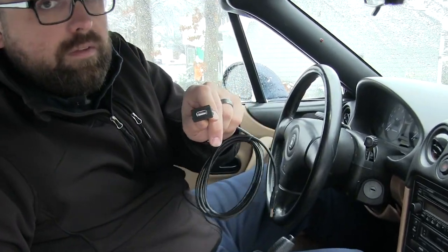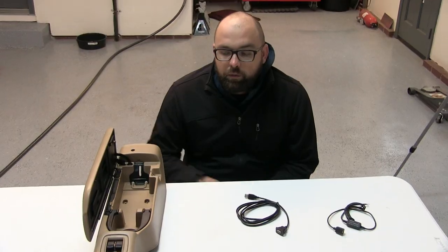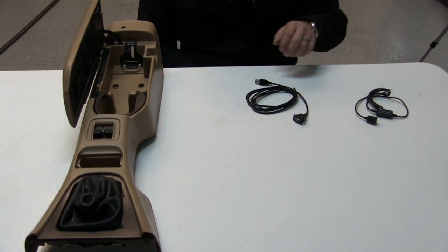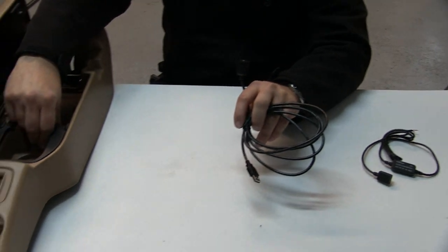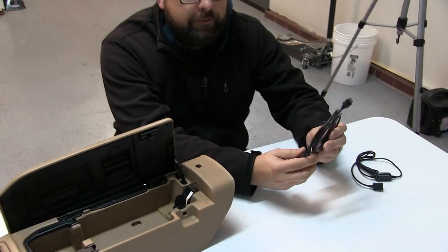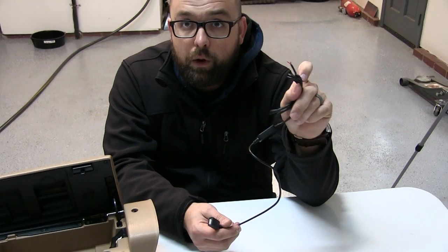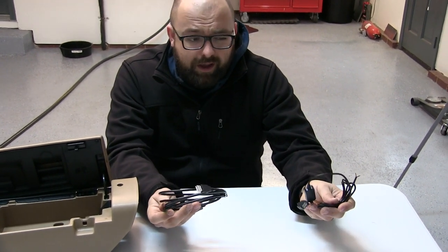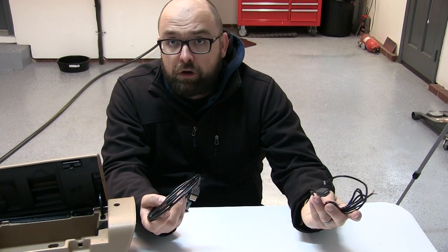This is the part that will be sticking out, and in this car we're likely gonna install it in the center console or maybe where the ashtray is and hide it away. We've decided to install our USB port in the center console of this Miata. The first piece we're gonna need is a flush mount USB port with a cable attached, and the other half is a DC to DC converter that converts from 12 volts down to the 5 volts needed for USB charging. We picked both up on Amazon for about $10 to $12 each, so you can get both for less than $25. We'll throw some links in the description.